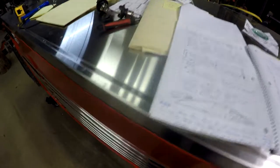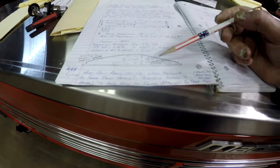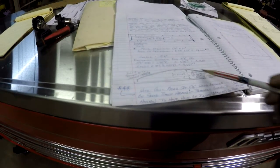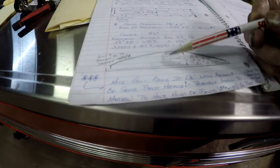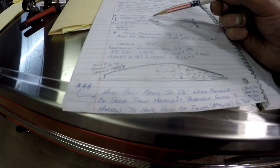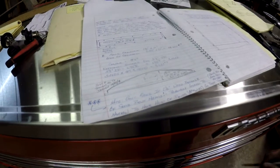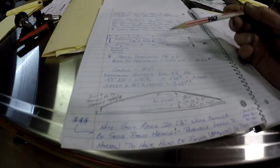So what I was going to do is build an air intake out of metal, and it would have been domed and open that entire way. That opening is approximately 2 1/8 inches wide, so what it would have been is approximately 2 inches, because I would have had to hold it back a little bit for welds so that I could get bolts in beside the sidewalls and the welds back into the flange of that intake manifold. So it's approximately 2 inches by 21 inches long.